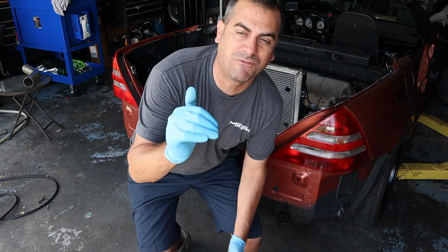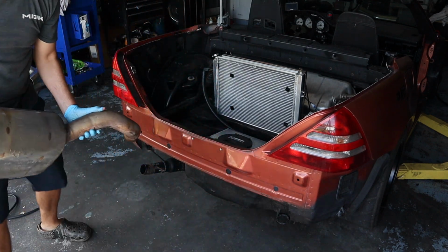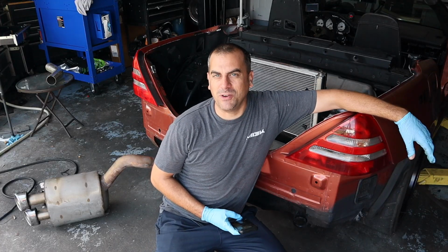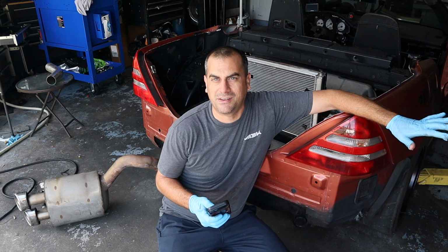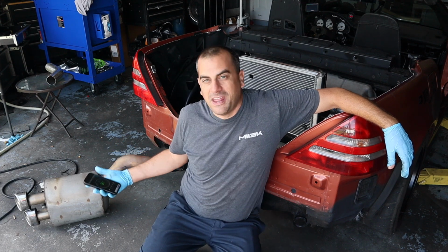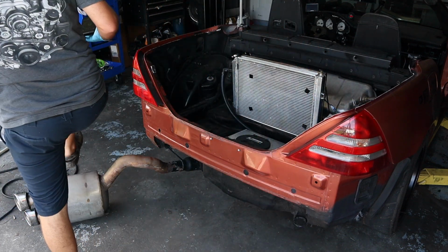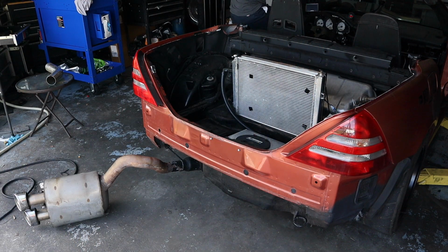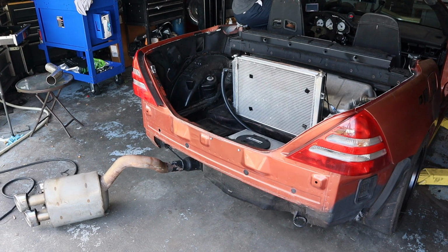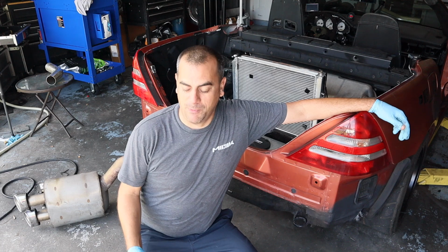So we're going to do the same thing but throw the other muffler on. You're literally going to hear a tone difference right when I put a muffler on. The SLK320, literally I don't even have to shout anymore. It's so quiet. And for decibels, it's now 78 to 81. That's a pretty big drop. Let's give it a little rev. That one only hit 85 decibels, so it's definitely quieter.